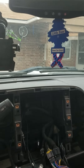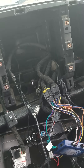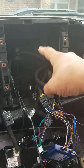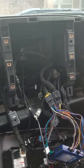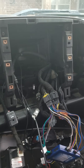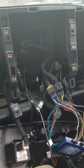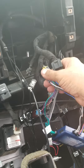My backup camera is in the rearview mirror. The RP5-GM31 comes with a cable for the rearview camera, but that cable is only good if the rearview camera is already in the dash — if it shows up in the navigation system on the dash. If not, it has to be hardwired into the vehicle, which doesn't exclude the video showing up in the rearview mirror — it just mirrors it.